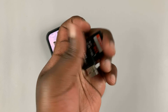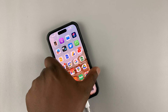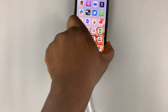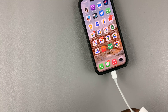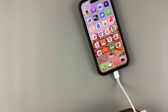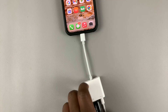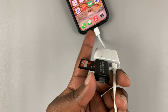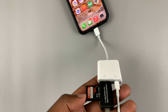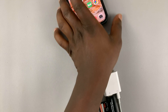Just like that. Then connect the USB Type-A port of the card reader into the Type-A port on the adapter. So this is what you'll end up with — the SD card in the card reader, the card reader in the adapter, and that goes straight into the iPhone.